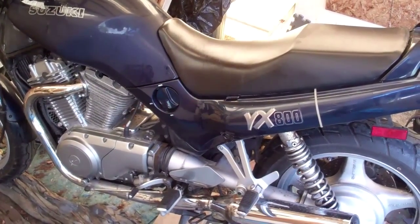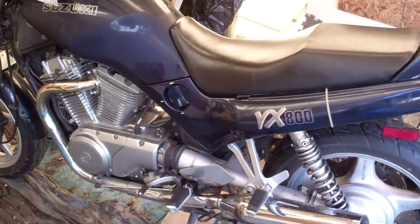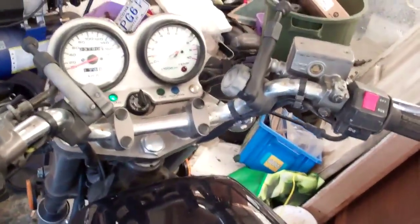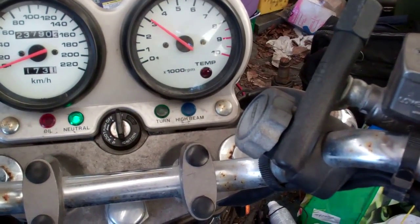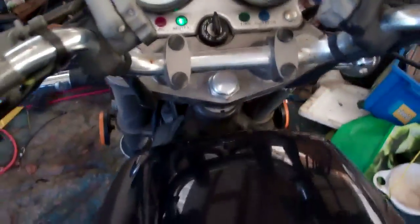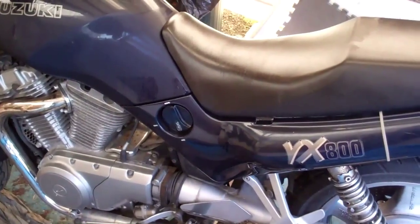I just came off the highway — this bike is nicely warmed up, no carbon or anything like that, and I've had it for some good runs out on the highway. Now I'm just going to show you what I mean — I'm going to give her a little petrol here. As I say, this bike is warmed up, shouldn't be any reason for it to be spitting like that, so step number one will be to change the spark plugs. Won't do any harm, might fix the problem.